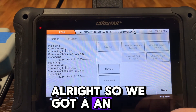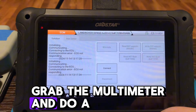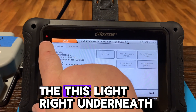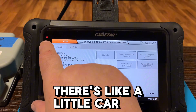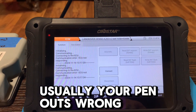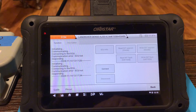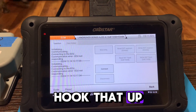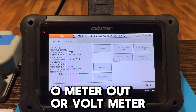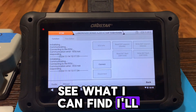All right, we got an error. I'm gonna grab the multimeter and do a couple of tests. Usually when you don't have power, there's a little car indicator light that comes up when it's thinking. When you don't get that, usually your pin out is wrong or you're not getting power to the ECM. I'm gonna bust out the good ECM, hook that up, get the voltmeter out and see what I can find.